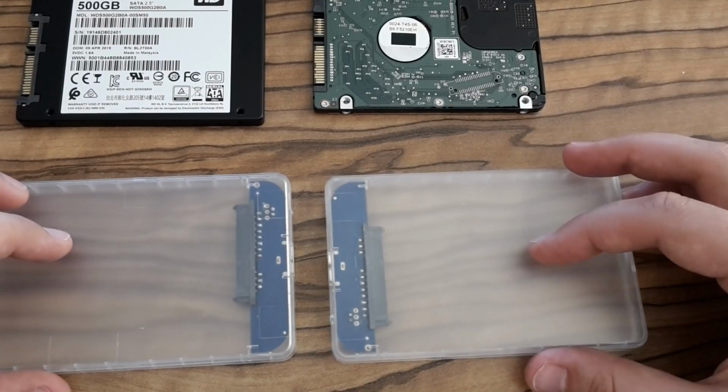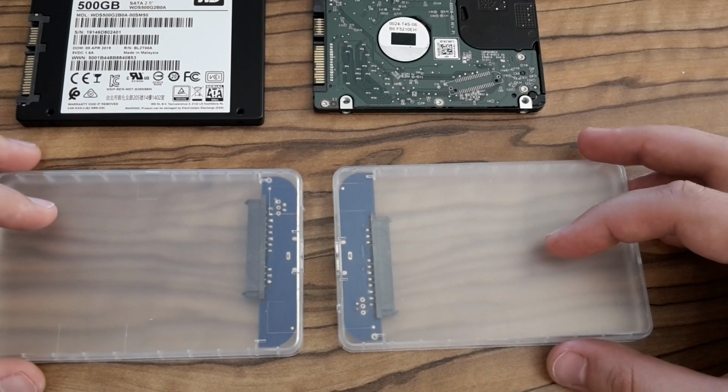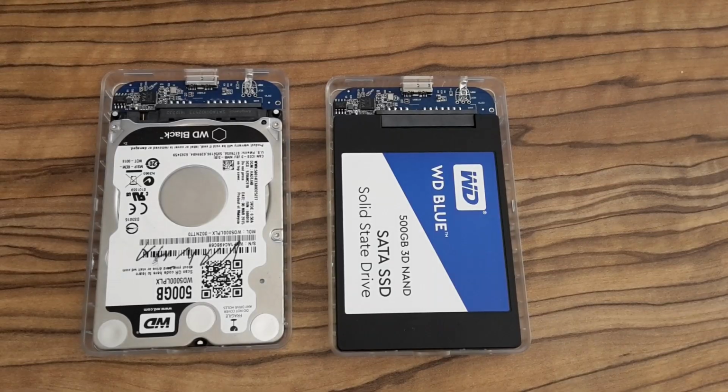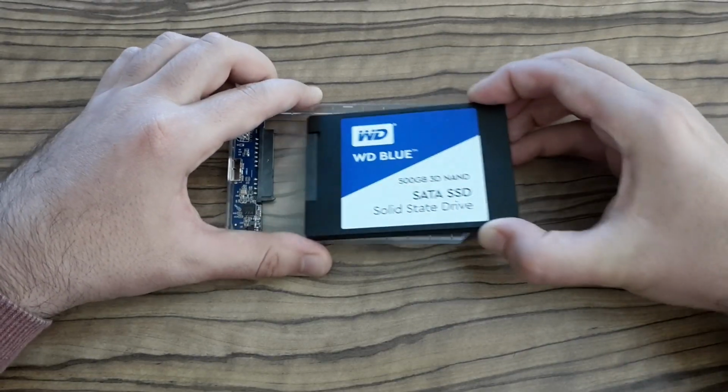I'm going to put both disks into these cases, which I bought on AliExpress for a few dollars. Link to them you can find in the description below this video. After putting them in the cases, it looks like this. Now I'm going to connect them via USB cables to my computer and use the Macrium Reflect application, which is free to use, to clone the operating system. Okay, I've already made it.